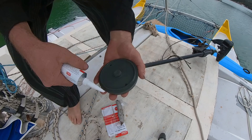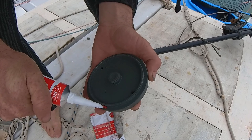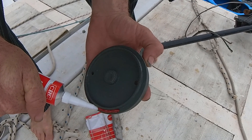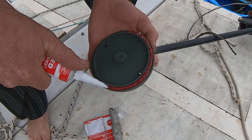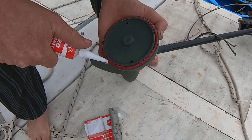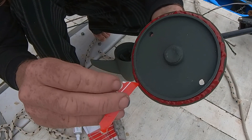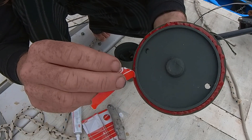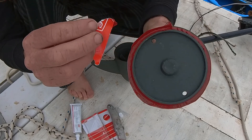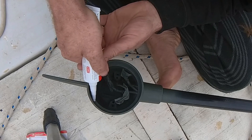The gaskets were clearly important to keep the water out, but they didn't want to go back in. So I'm using gasket sealant compound instead. In a petrol motor the gaskets get hot and have to resist oil and fuel, but on this motor it only needs to keep out water and won't even get very hot. It didn't go on as smoothly as I'd have liked, but it seemed soft enough that it would squash down when I did up the bolts.